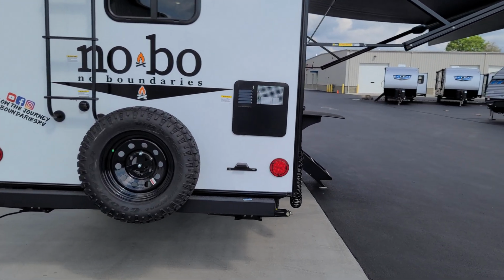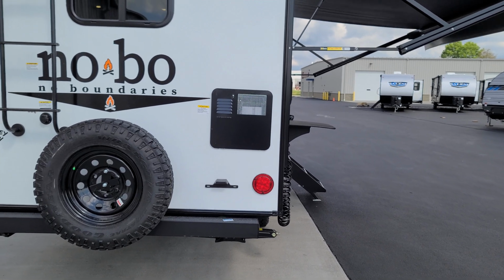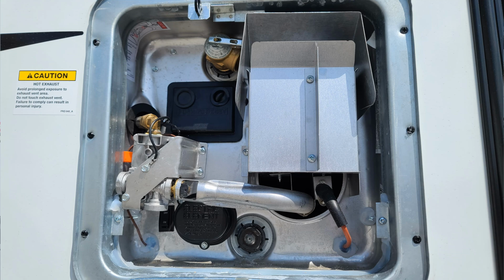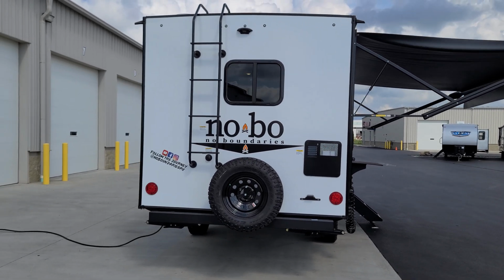6-gallon gas electric water heater on the right. Flipping down the lid here, you can see 1 1/16 drain plug to drain it out in the lower middle, electric switch to turn it on electric in the lower left, pressure relief valve in the top center. Make sure you relieve the pressure before you try to drain it.